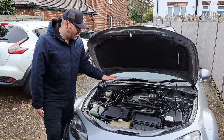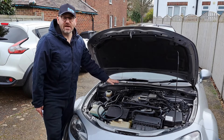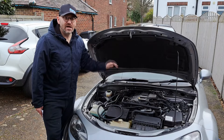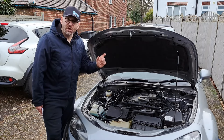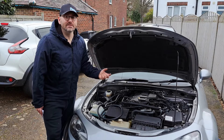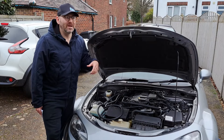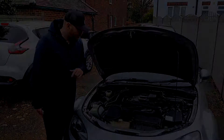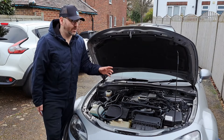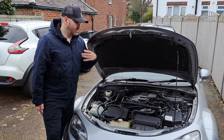So this is the real start of the build. I'm using a Saab TD04 19T turbo. The CHRA — the centre of the turbo — has been upgraded with uprated bearings and a billet turbine wheel, so it's lighter, has more blades, and should spool quicker. Power-wise, I'm not aiming for 400 brake horsepower — this is my only car and I need it to be fairly reliable. I just want a modest BHP improvement.